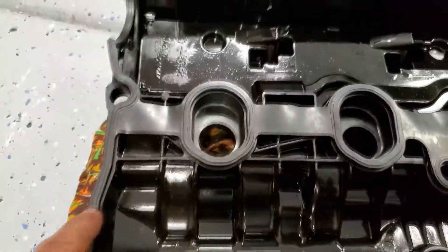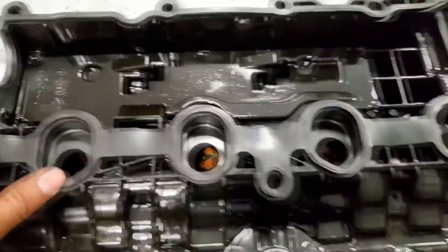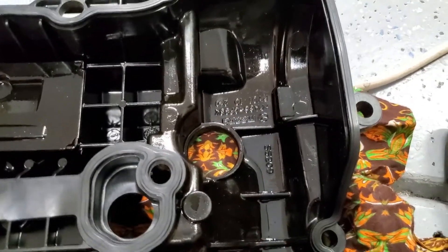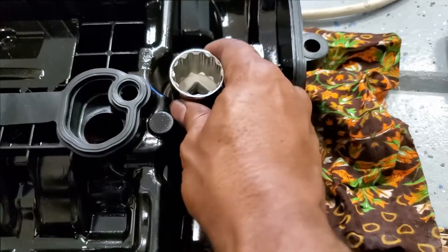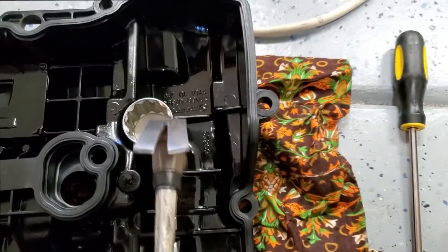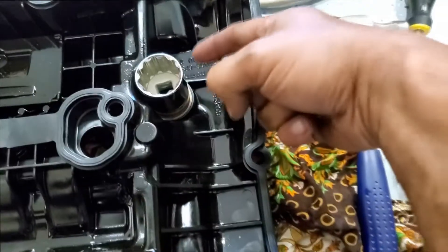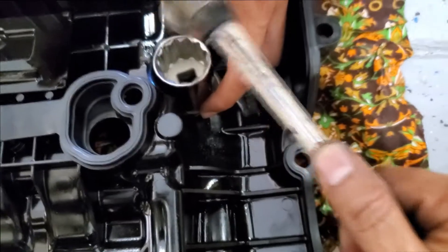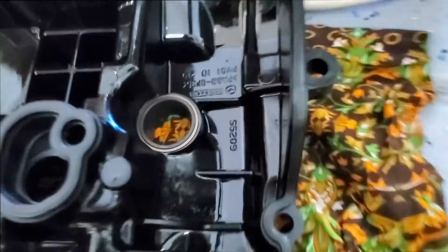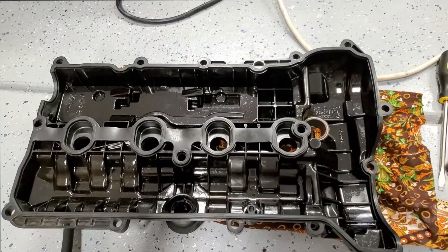We have got the gasket almost done. I am going to push this in and we are now going to install the oil control valve gasket. Now that the gasket is in, make sure it is properly seated. Grab one of the largest sockets that you have, place it on top of it, and then hammer it down — it is best done using two hands. This just ensures that the gasket gets seated correctly. Now I have got the gasket installed, the new grommet installed, and we are pretty much ready to get this thing installed into the vehicle.